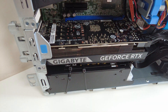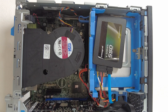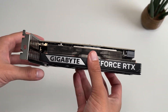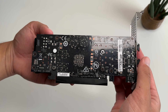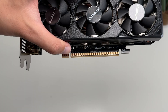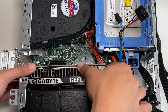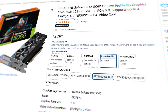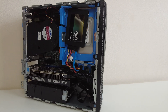So our Chinese power supply looks like it held up pretty well. If you were using higher-end components then it could be a good idea to get a Flex PSU from a better brand, but for our cheap Dell Optiplex it works great. The RTX 5060 is most definitely being held back by our PC, as an i5-9500 is quite an outdated CPU with only support for PCIe 3.0 — meaning we're actually limited to PCIe 3.0 x8 since the RTX 5060 supports PCIe 5.0 x8. This video is more to show you how you can put a dual-slot GPU that requires more power into a small form factor Dell Optiplex, as Dell Optiplexes tend to be quite similar for the newer versions. The RTX 5060 costs around $350 and the Dell PC only costs around $150 or less, so there are definitely better combinations of GPUs and PC parts out there.